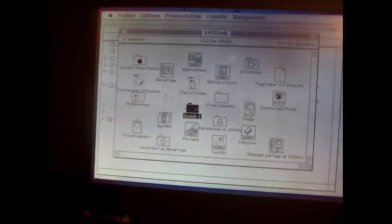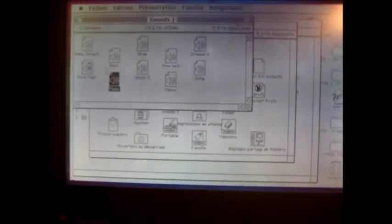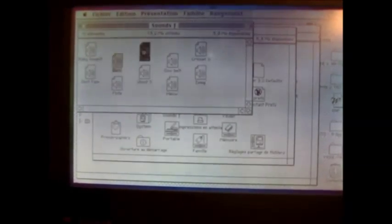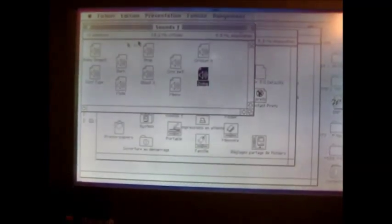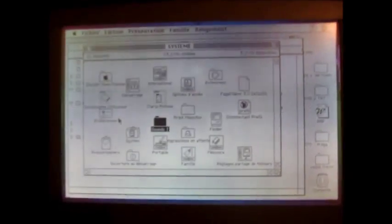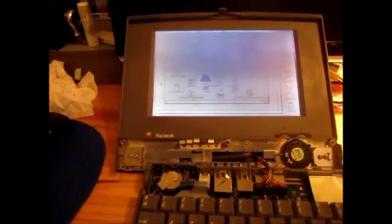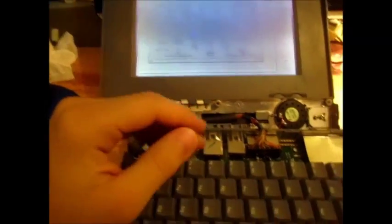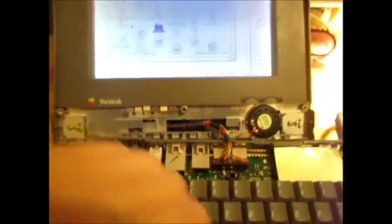The machine appeared to have been last used in 1998. I think I will do a review video of this machine when it's back together with another hard drive. Hopefully, with new capacitors on the board because those little SMD capacitors are leaking, and it sometimes prevents startup — the screen stays black, which is a known problem. The capacitors are at fault and I need to change them.